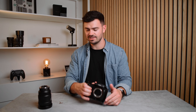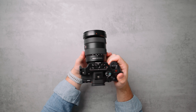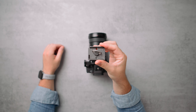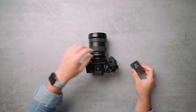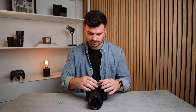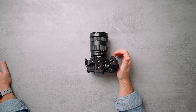Next I'm going to reattach the lens so that everything is nicely put back together. After that I'm going to attach one of these Manfrotto RC2 plates. I use these on all of my cameras because they're on all of my tripods, gimbals, sliders etc., and it just means I'm not wasting time removing or attaching plates to various cameras. I'm just going to attach this to one of the quarter-inch threads on the bottom of the camera — once that's tightly attached it's not going anywhere. Pretty solid feeling so far.